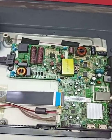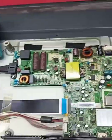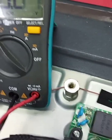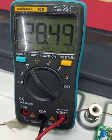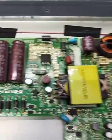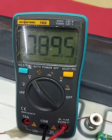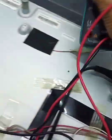I already changed the capacitor. Now we check our supply. DC 28 volt — now it's okay for the backlight. Now voltage is 89.5 volt. So let's check our picture.